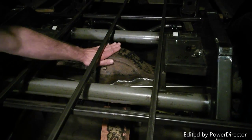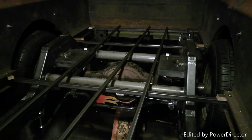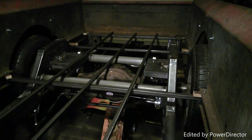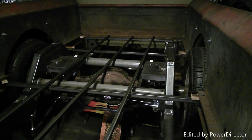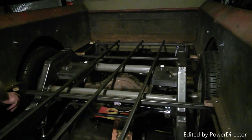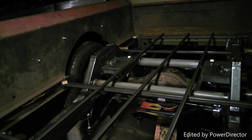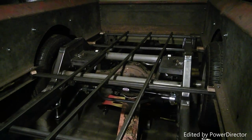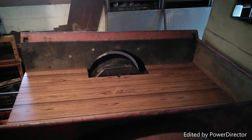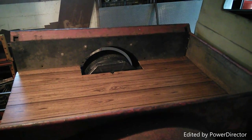With the rear end jacked up all the way and a piece of three-quarter inch tube on there, I can still get my hand in - it's about three-quarters of an inch clearance. That's how I made it so I could have the wood bed on there. I'll probably end up with at least five of these pieces of three-quarter inch tubing, weld them all together into one big grid, then lay the sheet on top, take a little off the supports so it lowers down, and the plate will be underneath the lip. It's certainly not a real low truck - I'm just going for more of a street, broad-stance look.